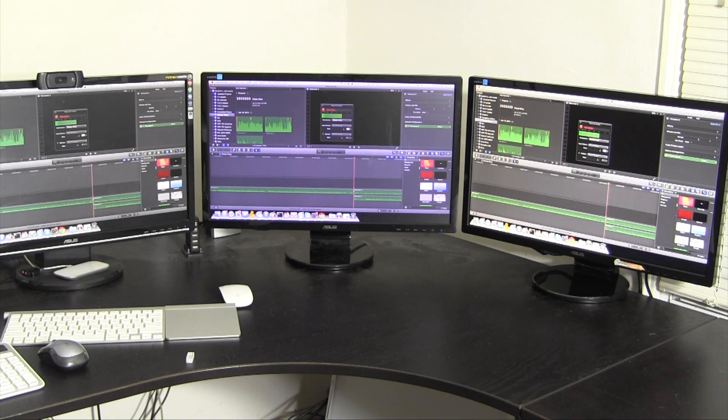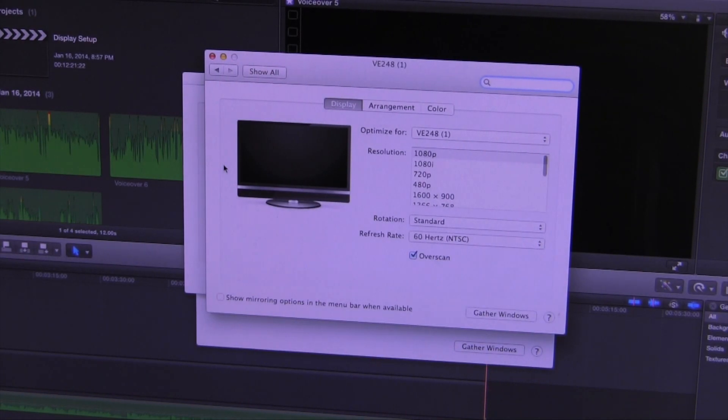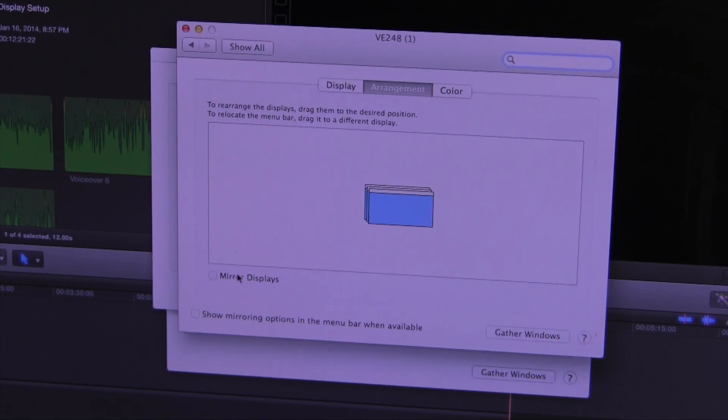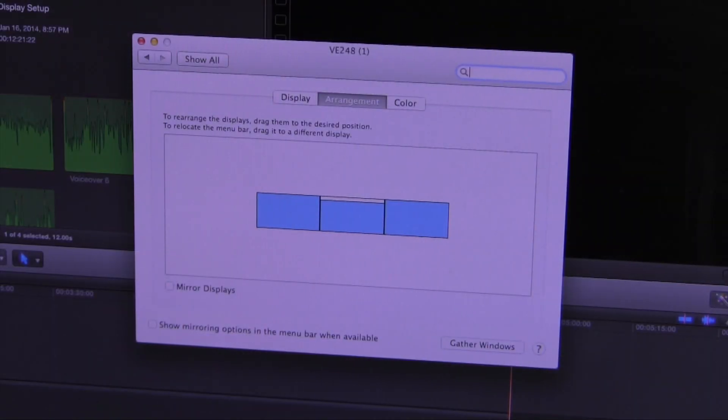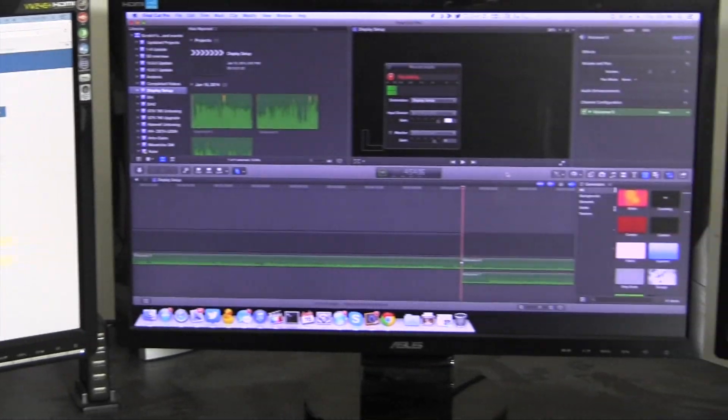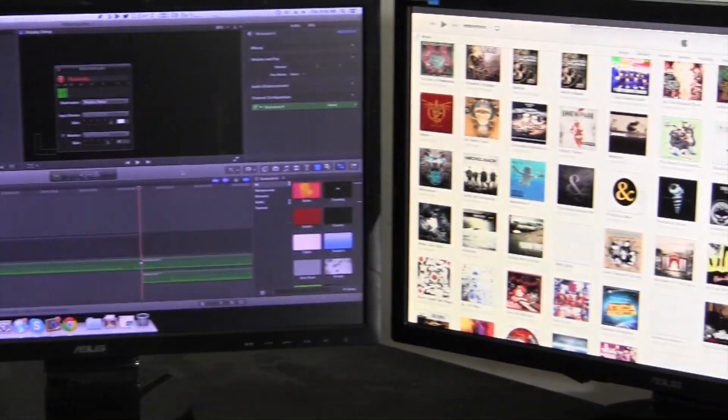And we have a success! But as you can see all the displays are mirrored, so now we just have to turn mirroring off and we'll have a successful triple display setup. Turning off mirroring in OS X is found within the Displays portion of System Preferences — after clicking the Arrangement tab, unchecking the option to mirror displays will disable mirroring. It's really that easy to get a triple display setup on a hackintosh, assuming you pick the right hardware of course.